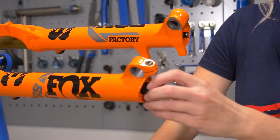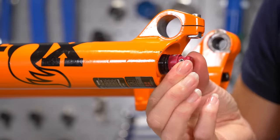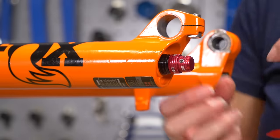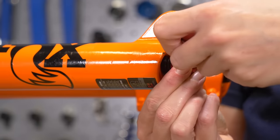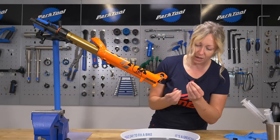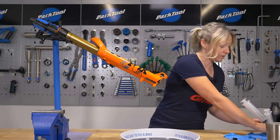Take that cap off over the rebound dial if you have one — you'll have a two mil bolt holding on your rebound dial. Just go easy with that, be gentle with it. It shouldn't be done up too tight and it will be a little bit spring loaded sometimes, so be careful it doesn't fire across the workshop. You'll have a little one, a spring, and then the bigger one. Set that aside.